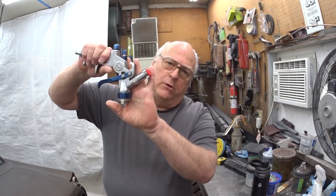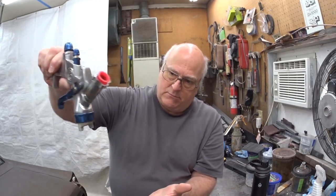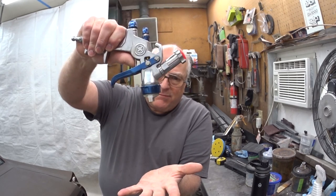If the temperature starts to change, I can move the gun in closer — we're talking about how fast the droplets are drying. If I'm using lower pressure, my droplets are bigger and they take longer to dry, so they hit the panel wetter for any given distance. Pressure is one adjustment; the next is how fast I'm moving the gun, controlling how much paint I'm putting on by my fifth pass. If things are flashing off too fast and I move the gun in, I'll have a smaller fan but it'll put on more paint faster and hit the panel wet. We're only talking milliseconds of dry time difference moving the gun a few inches closer.